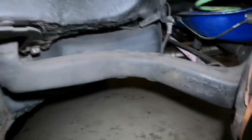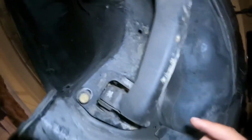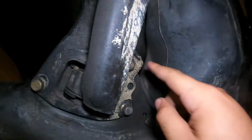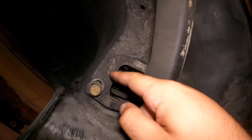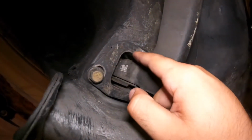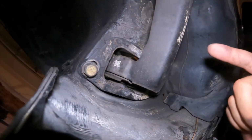All right, guys, so once you take the wheels off, you expose this arm right here. This arm right here is where it goes. That is it right there. It's pretty much what you're gonna do. So you're gonna come under and pull this plate off. It's 3 bolts, 1, 2, 3. You're gonna pull that off. This is actually the adjustment for the toe, for the arm to go back and forth, and that is the bushing in there that we're gonna have to change. So undo those. Once that's done, you'll be good to pull it off.